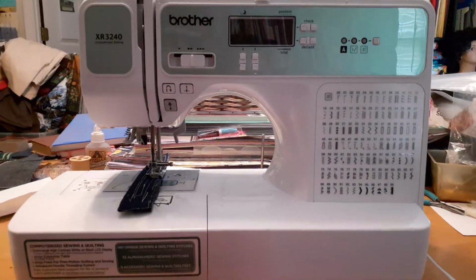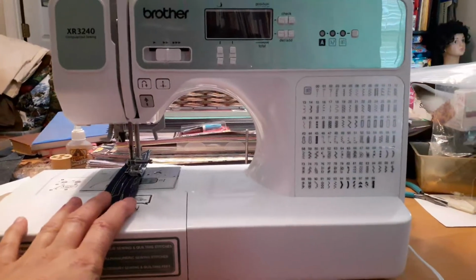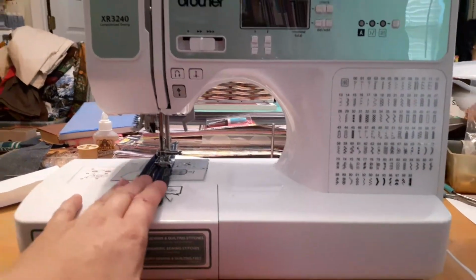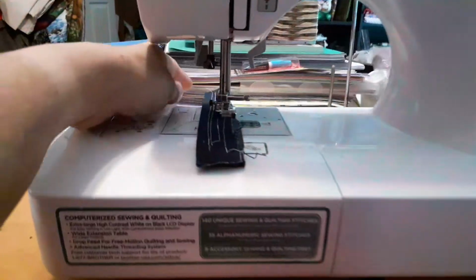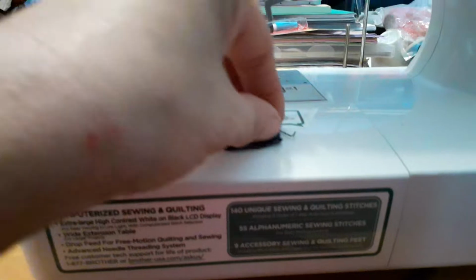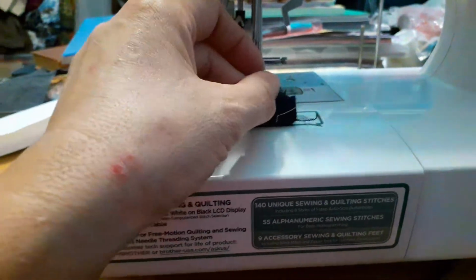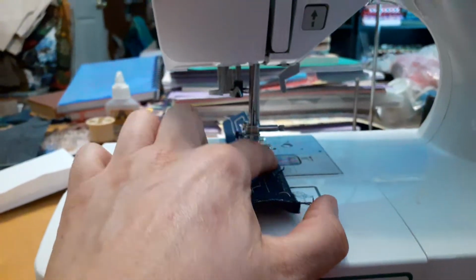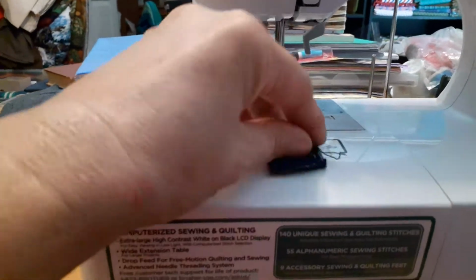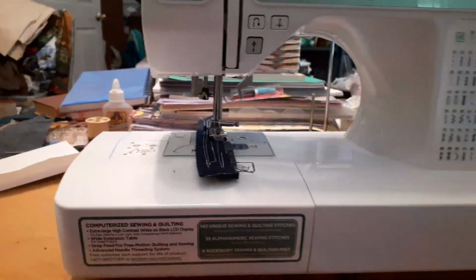Anyway, I'm going to let you guys go. I just made a short little video. Just make sure when you're running one of these and you're having problems with vibration or whatever, make sure you have the right bobbin. And make sure if you have any tails on your projects or any thread that's running loose, and you go over it and it sucks it underneath, it will cause a really horrifying noise. It's because the machine's confused by there being more thread down there than there should be. So just make sure you trim off all those little loose ends so you don't get caught on things, okay?